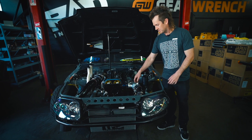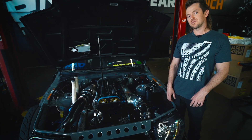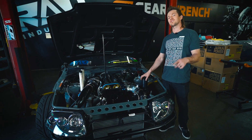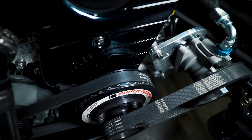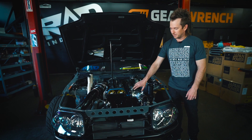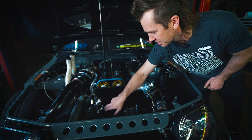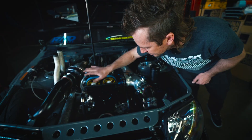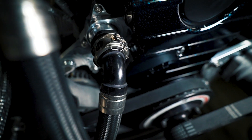Looking in here, we run the KRC power steering — we make a kit and this is the pro kit, the KRC PS3 which is their pro series three pump. I changed up my reservoir and have a regulator back there that helps the pump live a little bit longer. There's a video on that system so check out the link. Going to the front of the motor, I do run an ATI damper so I can attach this KRC power steering setup. Moving up, you see these water inlet and outlet — that's something cool we came out with a little over a year ago. This replaces your water pump and lets you still utilize all your front plastics covering the timing belt. Everything would be covered when you're on the racetrack, and it also holds your alternator.